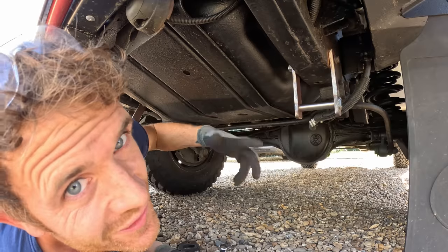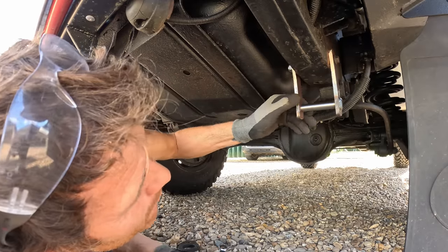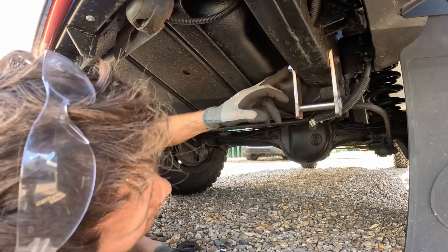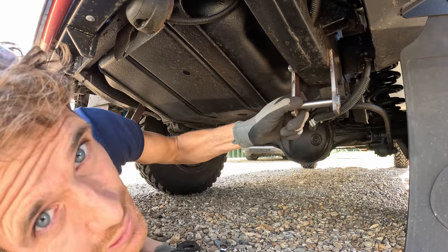The fabricated jake rings fit a treat — the original bolt at the top, an 8 mil plate dropping down, and a 16 mil bolt at the bottom through a 60 mil bar. The weakest point will always be the top bolt anyway. Really happy with them — just need to get them off and painted.